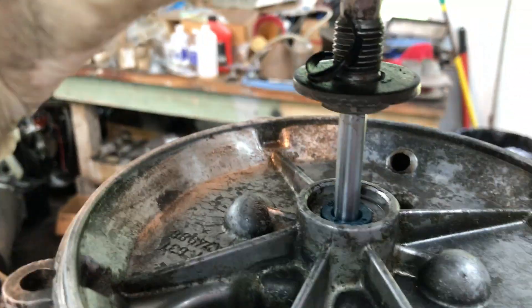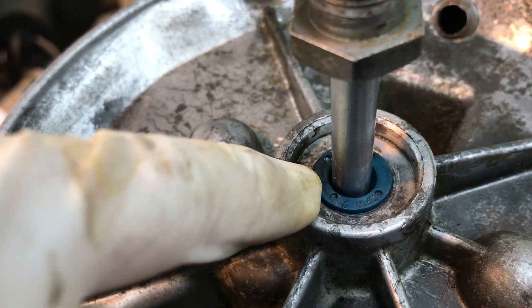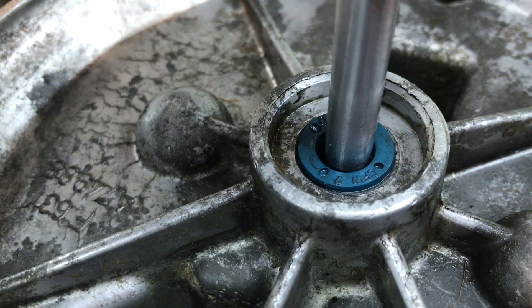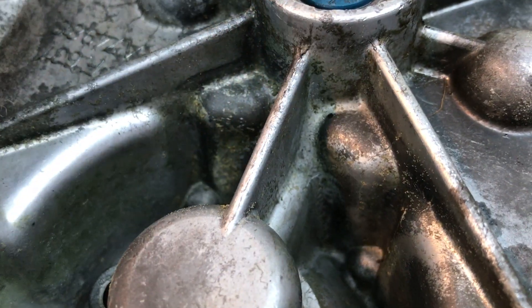This diaphragm goes on here like this, but the issue we have right now is the seal right here. This is a critical vacuum seal that keeps brake fluid and vacuum away from each other, and this thing has just got no sidewall to retain anything. If you look down there you can actually see the brake fluid — we don't want to be seeing brake fluid here.